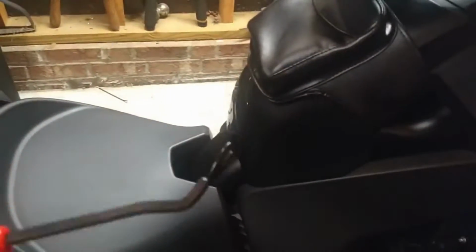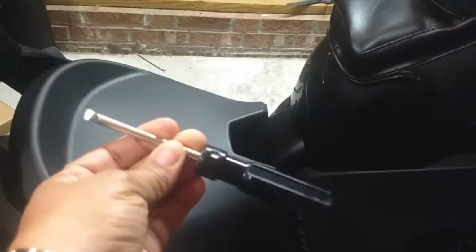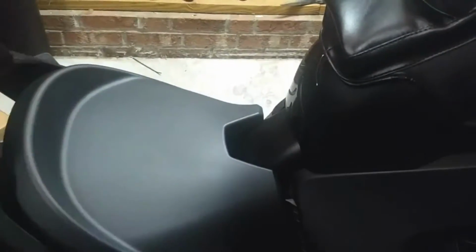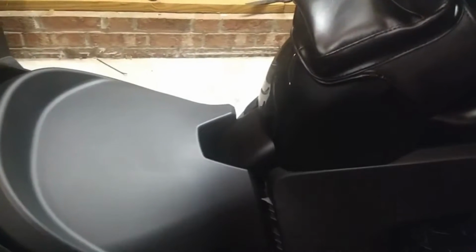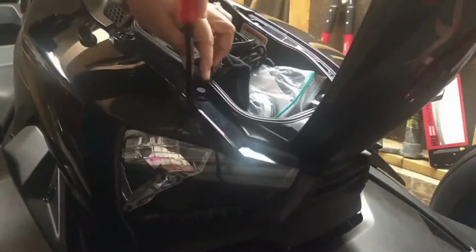Make sure you carefully remove those, and you want to ensure that you have a special tool to remove those push pins. You can order those tools from Harbor Freight, La Monster Garage, slingmods.com. You can also try a flathead screwdriver to help you lift it up, but I recommend the tool.